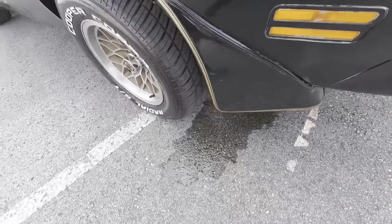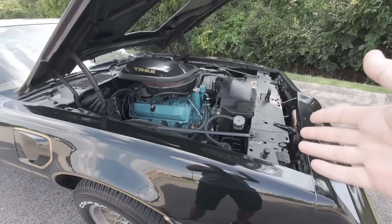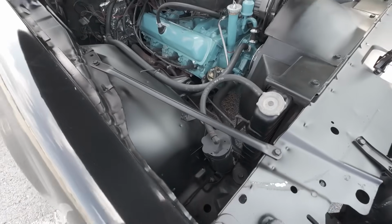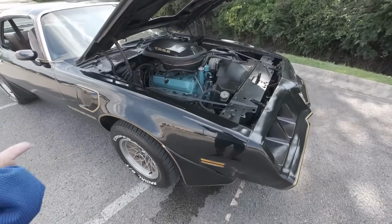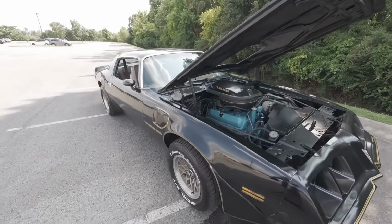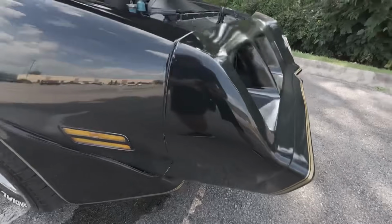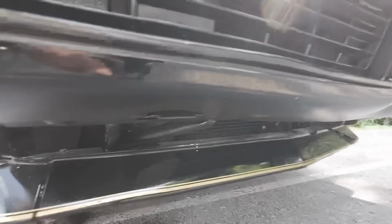I know it's not overheating, but we top off the radiators when we get the cars in, and it looks like it's leaking from the top of this. It overfilled the whole canister, so it had nowhere to go. We always top off all the fluids and check our fluids and everything. A lot of times they put a little bit too much antifreeze in there. When I go to test drive it, it warms up to the normal temp and spits out the excess that it can't hold. That's what happened here. I would let you know if I saw any kind of overheating issues in this video. I do it all the time.